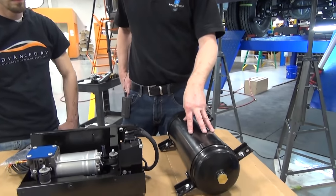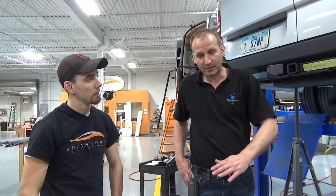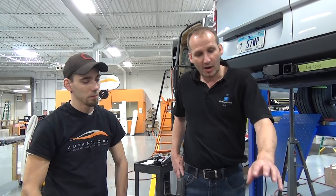The main advantage now is we've got an extra air tank on the system. All the previous air suspensions didn't have an air tank, but now with the new generation we've added one. The air tank gives a boost when the vehicle is low and you want to raise it again. For example, if you're at a camping site and you lower the rear of the vehicle for easy access, normally it would take half a minute to a minute to raise. Now with the air tank, it's done in just a few seconds. That's one of the main changes we made to the system.